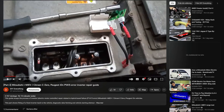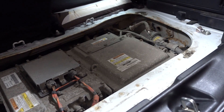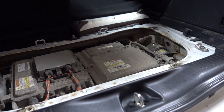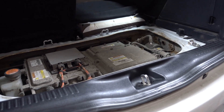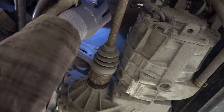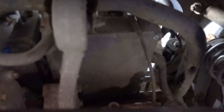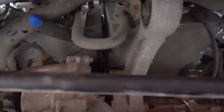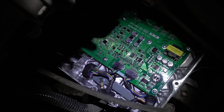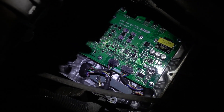That leads me to the next step: removing the inverter. The rear of the car is lifted up quite significantly and we're ready to tackle the inverter and inspect the PCB. Normally you can remove the entire box from the car — you just have to drain the coolant — but I'm going to try doing this from below instead to save time. I got all the bolts out, which was not fun. I pried the cover off using a knife to start it and then screwdrivers along the edges. This is not really that simple, and the more I think about it, I should have gone the long way and drained the coolant.